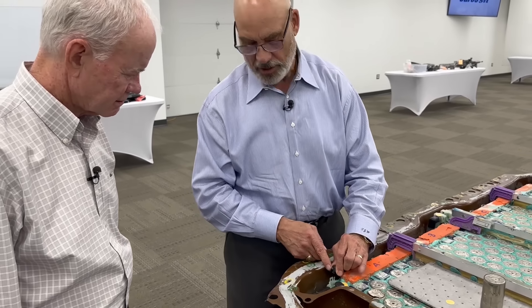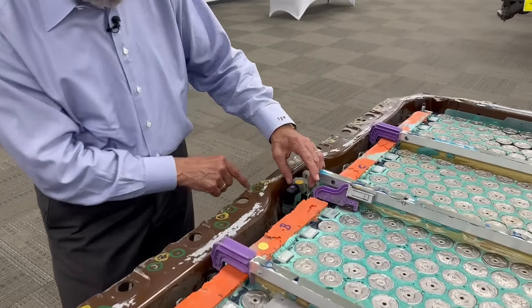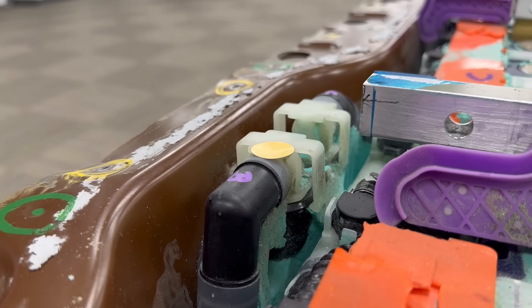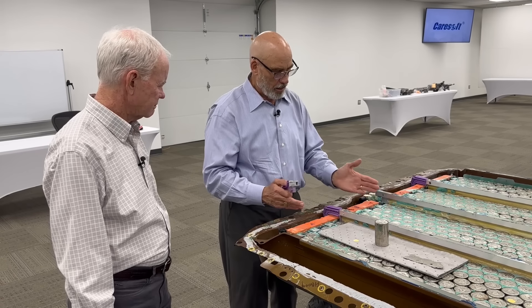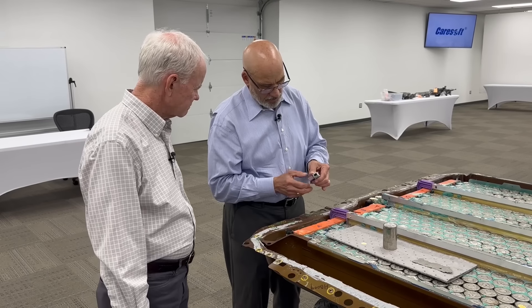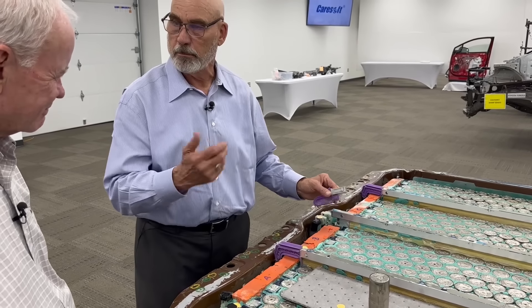Here is another one — our guys broke it trying to get it off because you have to figure out how it works. But you can see it's here and here. This is a bigger one — a larger piece that comes right off the inlet and outlet — and you can see the design: it just snaps too. The various sections of the battery, the 200-volt sections, are separated and insulated both electrically and thermally by these dividers. There's a seal that seals up against the battery bottom, and even that seal — the way it's designed — has snap fits. That seal just comes in, gets pushed in, and pushes until it clicks into that hole.